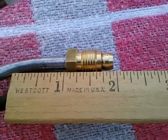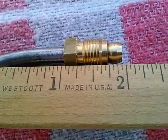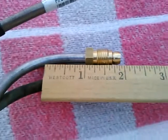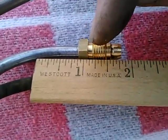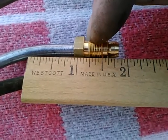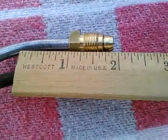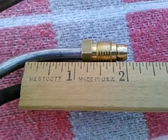But again, it adds up to just a tad under 1 inch long in overall length, which is important. You can only tighten this nut until this hits the fuel pump and you can tighten it no more. So the length of this determines how securely you can jam and compress the ferrule into the fuel pump.